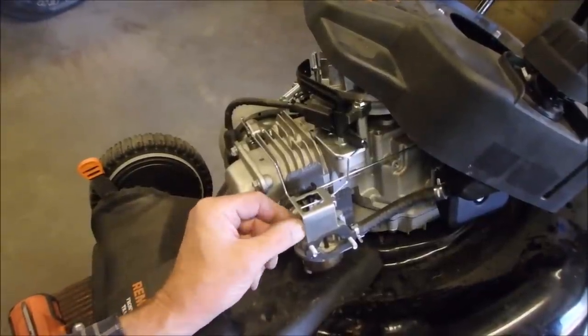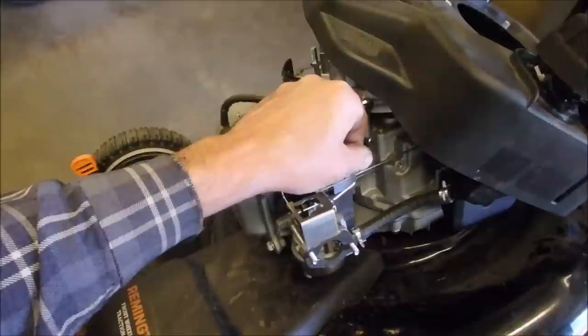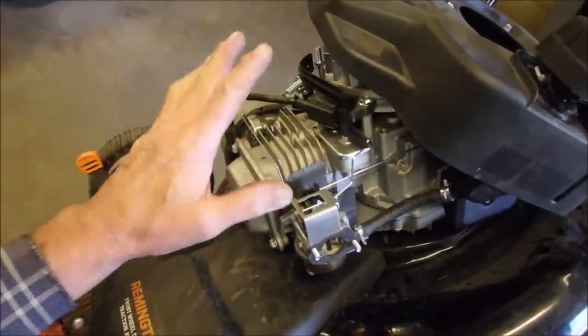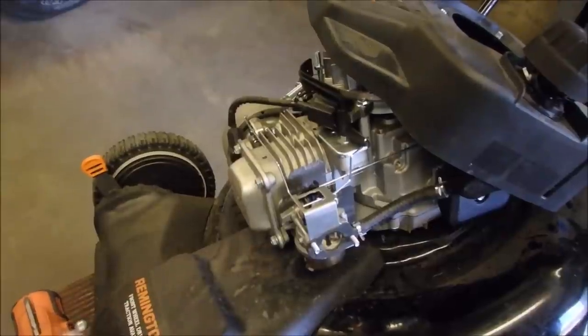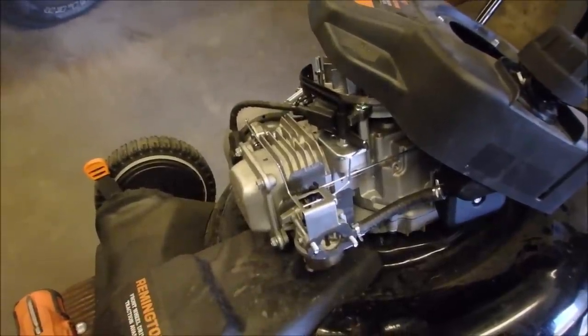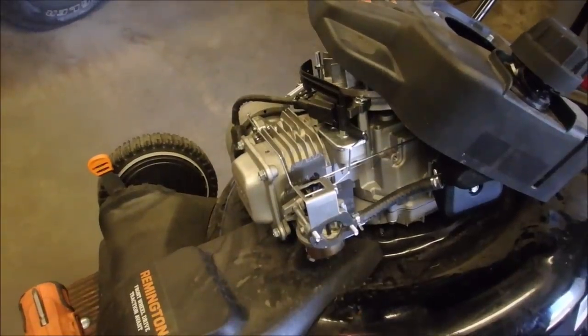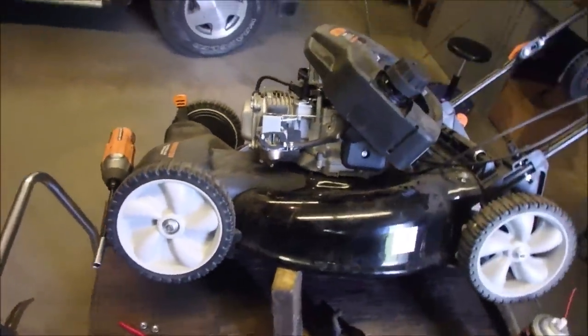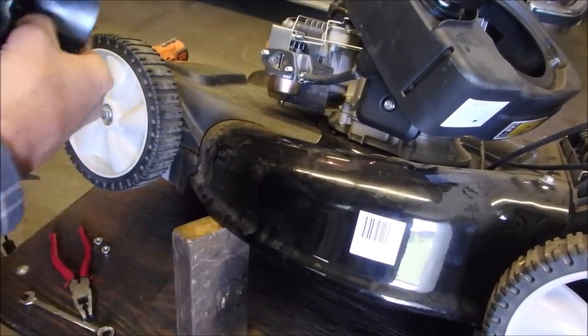The little choke is in between this lever and also this lever. Can you see the choke operating there? And so now it all goes back together at the same time. I'm going to try and put the cover of the carburetor on first and then the rewind with the gas tank on last. And I cleaned out the gas tank too. So now it's just a matter of getting the vent hose in the right spot, which is just underneath there. They're always a pain, eh?